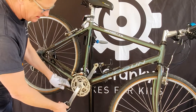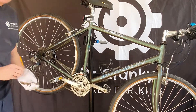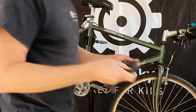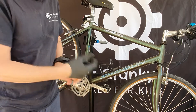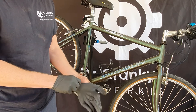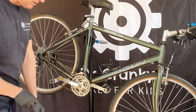Now there's something wrong with this one — you can hear it's got a stiff link on the chain. Before you touch the chain, put some gloves on — washing up gloves will do — because your hands are going to get dirty. Sometimes you'll get a stiff link, especially if you've recently changed the chain.